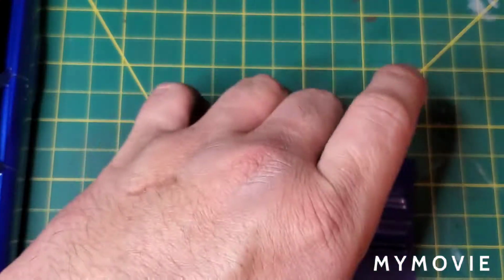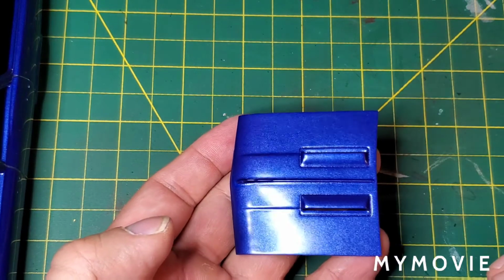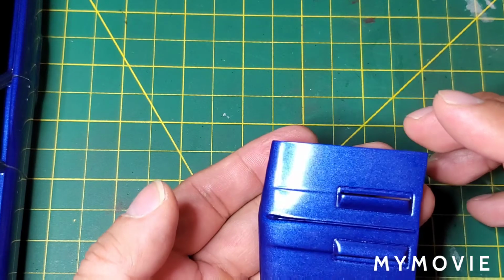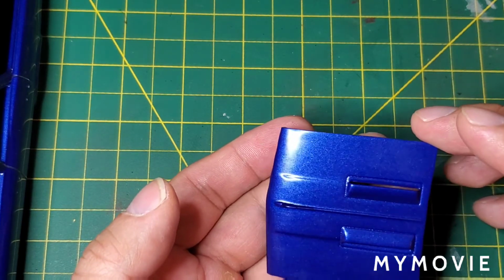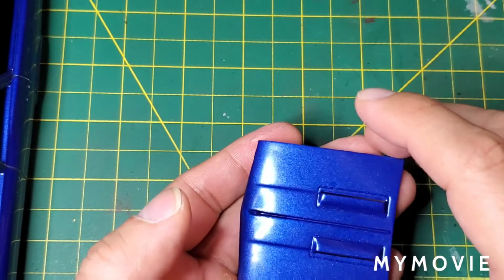And then I had to put some more color coats on the hood. So that's looking good and covered, and I had to sand out a couple little spots, dust particles, so that's ready for clear.